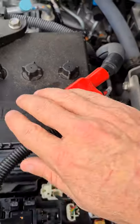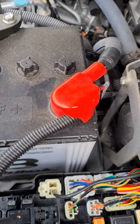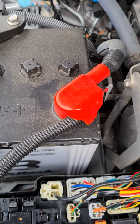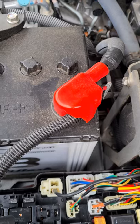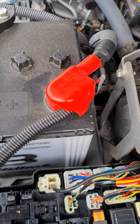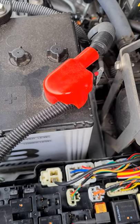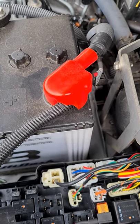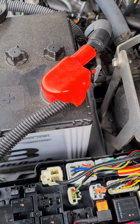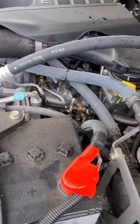If you're not familiar with smart alternators — basically once they've recharged the crank battery to save fuel, the alternator winds down and only provides a trickle charge. That can drop below the threshold of the DC-to-DC charger, so without that blue wire the DC-to-DC gets tricked into thinking the car is off and stops charging from the crank battery.